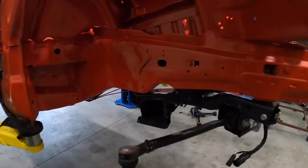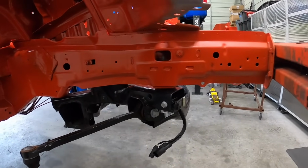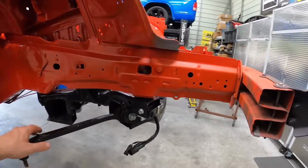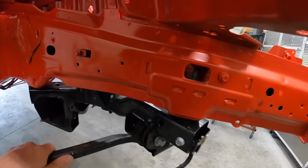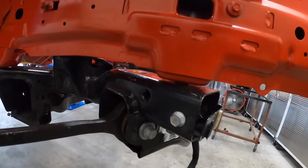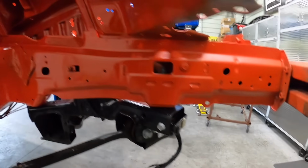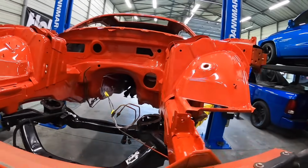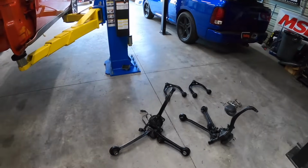Okay, so we got the cradle in here. The torque spec on them is 136 foot-pounds, so that's gonna be fun. So let me torque those down and then we can get on to the next stuff. Either way, the whole vehicle is gonna have to go for an alignment, but it is surprising that there is quite a bit of play on this. It seems like the rear ones, I wanna say, are a little more loose than the fronts. The fronts seem like they locate themselves fairly well, but the rear, there is the ability for this thing to move around. There's no dowels or anything on this whole thing, so definitely we will want to get this whole thing aligned, and we will once we get it back together. But that's that. So let me torque those down and then we can work to getting the suspension on.